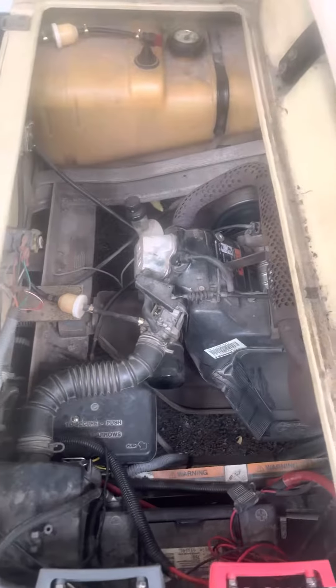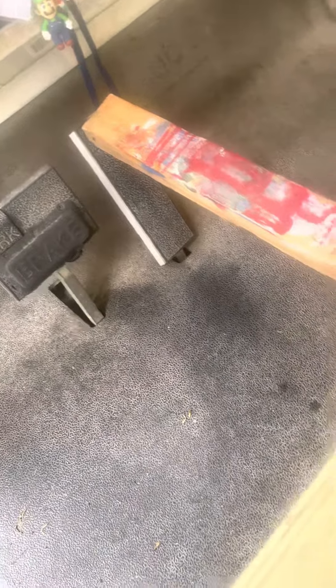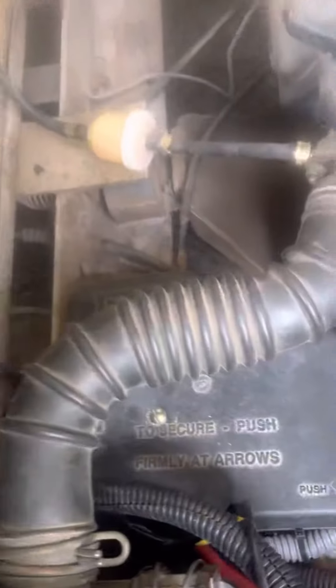Here's my Club Car — it won't start, but when you press the accelerator you do hear a clicking sound but nothing activates. What you need to do is make sure you put it in gear first, then activate the accelerator with a piece of wood or have someone step on it. You hear the clicking, which is coming from in here, which is fine.